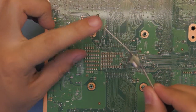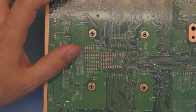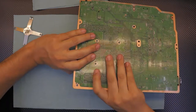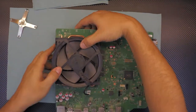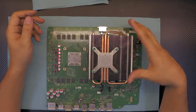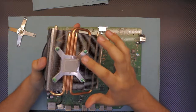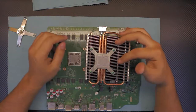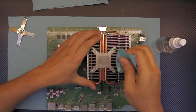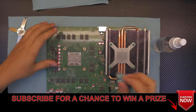Now this is the clamp — these are the things that hold the cross onto the heat sink. Once you have it removed, grab the heat sink with your thumbs and flip it over. Now you can detach the heat sink. First, use a can of air to clean the heat sink, then clean the thermal paste on the bottom of the heat sink. Clean it up with alcohol. These are the factory-applied paste and they are like some generic thermal paste — not really good ones.